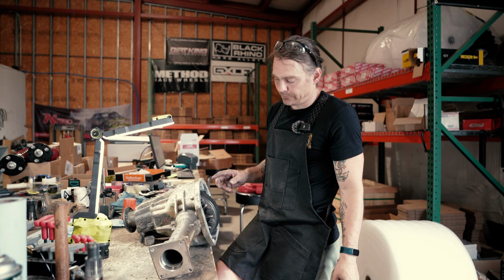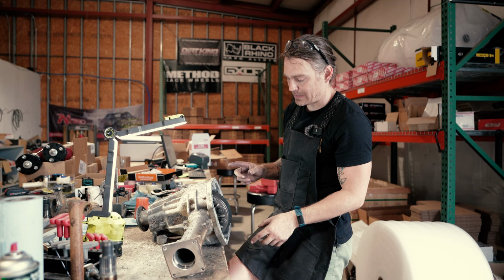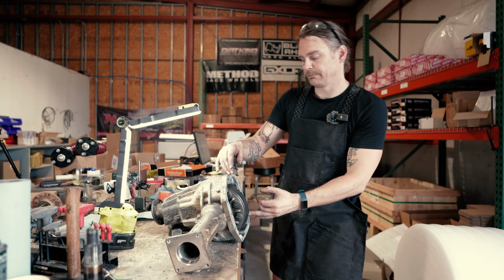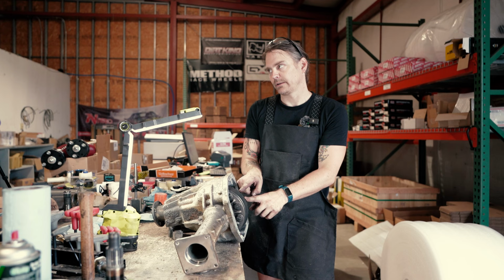Now on an M205, when you go deeper in gearing, typically when that happens, you're increasing the thickness of your ring gear and you're shrinking the head of your pinion. And on an M205, that becomes problematic because you have two ridges right here. And as you bring your ring gear closer and closer, you start to create a clearance issue. Now on our 3.692 gears, they're slightly thinner than these 4.08 gears. And we only had to really bevel the outer edge here very lightly, very slightly.